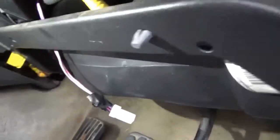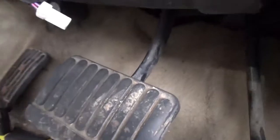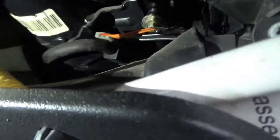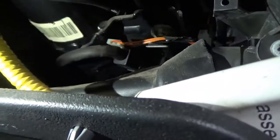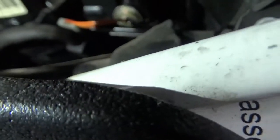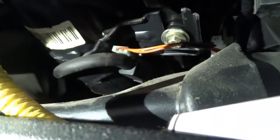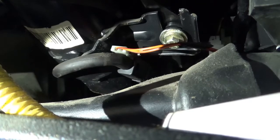So I'll pop that off and then see what else we got. So after a bit of digging, I found that vacuum hose. So if you take the brake pedal, we remove this cover here, and then above that, just there, is the vacuum hose. This is really hard to do holding it. See if I get my finger in there to point. So there, just where those orange wires go, is it? Yeah, orange, brown, red and orange is the hose there. Apologies for the bad focus there, and it's difficult to see.